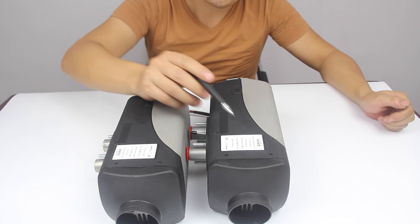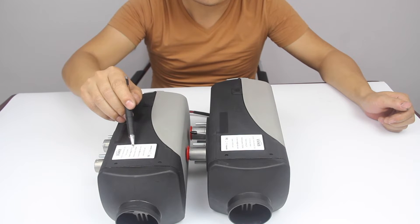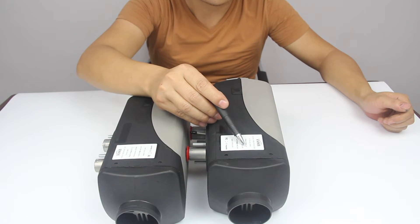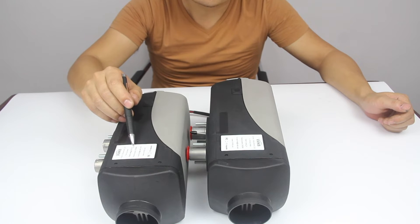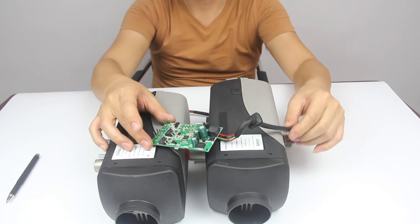To fix area 8, we need to check three places. First, whether the voltage of the parking heater matches that of the vehicle. Second, when you start the car, please check the battery voltage. If your heater is 24V, the normal range should be 18V to 30V. And if it is 12V, the normal range should be 8V to 15V. Third, please check whether the circuit board is broken.